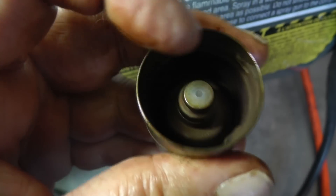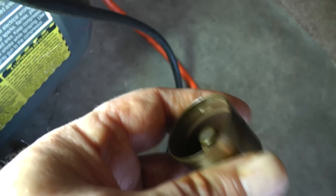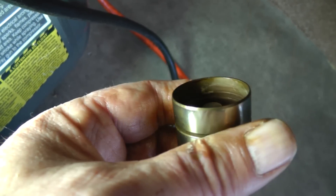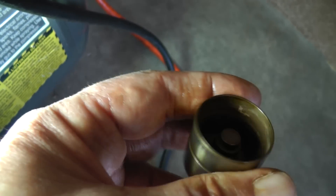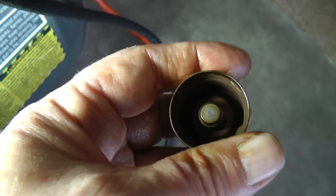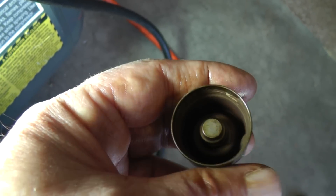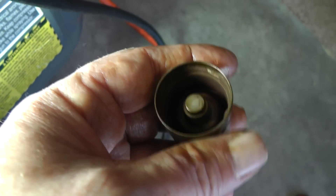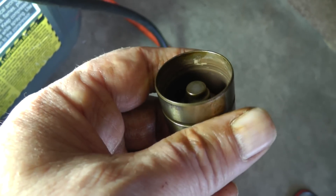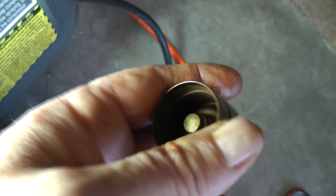If your oil has been changed regularly and is clean, you don't need to go through all this. I'm just worried about a little bit of particles and sludge up in here. The previous owners — as I mentioned — it looks like they didn't do any regular oil changes, so I'm taking an extra preventive step. You can put them in oil, let them sit, then put them in a vise, bleed some of the oil out, and allow the lifter to pump up. At that point you'll be ready to drop them back in.